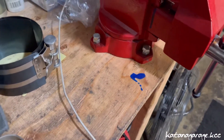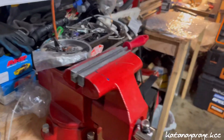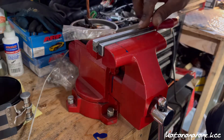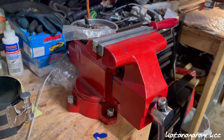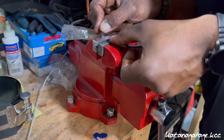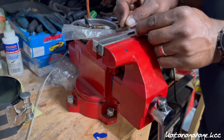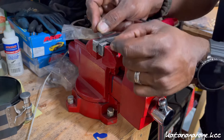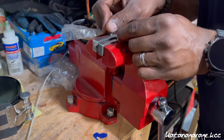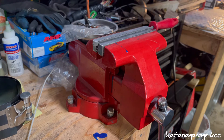I'm going to show you the method of using a file on a bench vise if you do not have a ring filer. Here's my bench vise — just ring it up a little bit. Get yourself a nice file and lock the file into the bench vise, then hold it nice and precise. Just run it easily, one side at a time, trying to be perfectly straight. There's really nothing to it — this is an old school way of doing it and I've never had any issues. You want to be super careful and mindful that you hold it straight and don't have the edges offset.